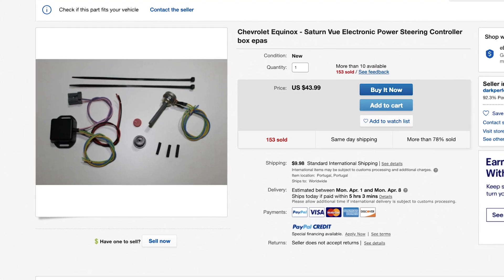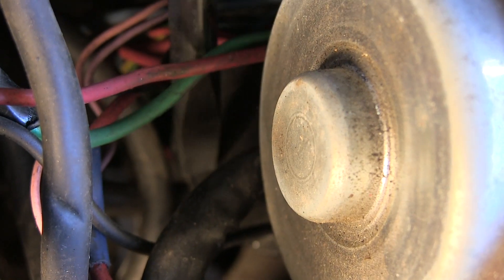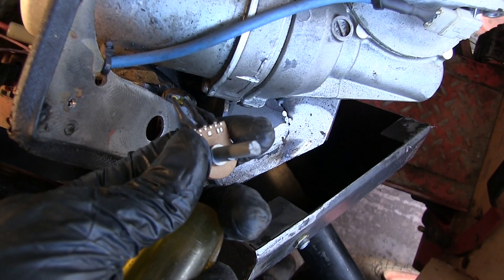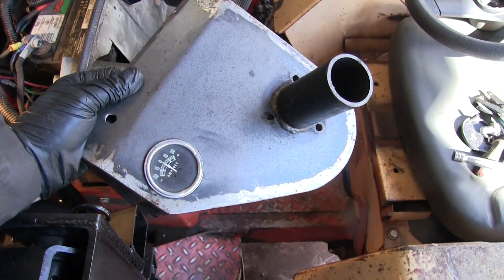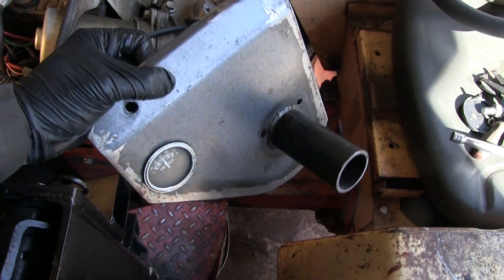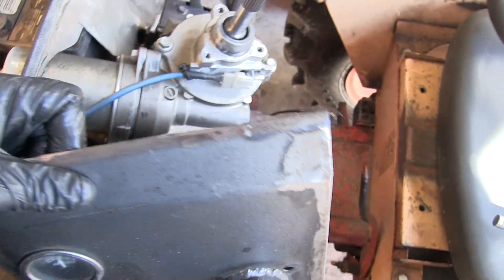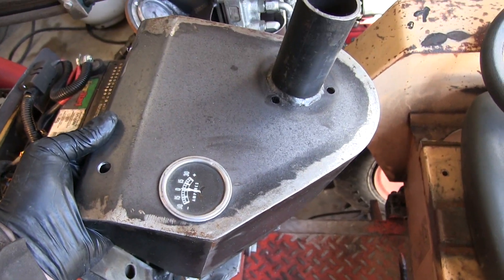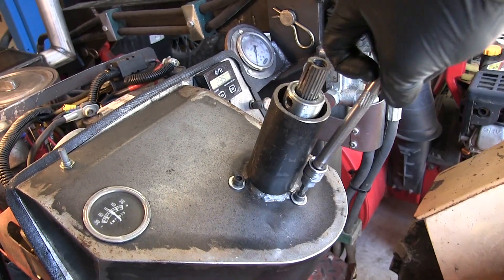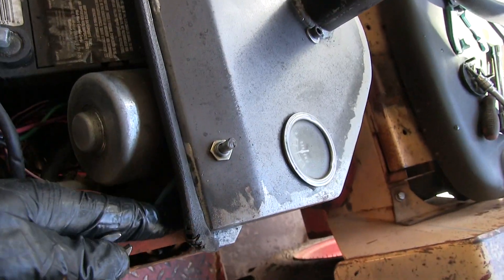You can pick these up from a variety of places, but eBay is probably the easiest and cheapest. Here it is tucked at the bottom of the battery tray. The position of this knob will determine the steering assistance level — I tend to like mine about midway up. The final component is this cover, made from 16-gauge steel, meant to keep everything looking nice and keep the components out of the weather. It's held in place with these three screws here — from the original power steering unit — and two at the back.